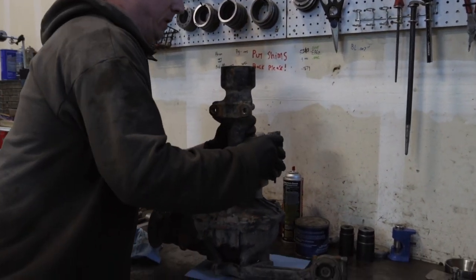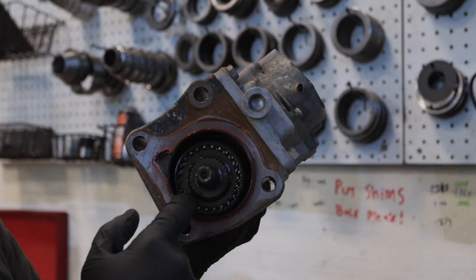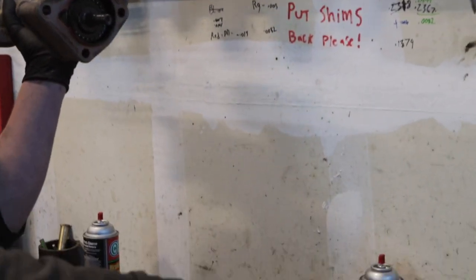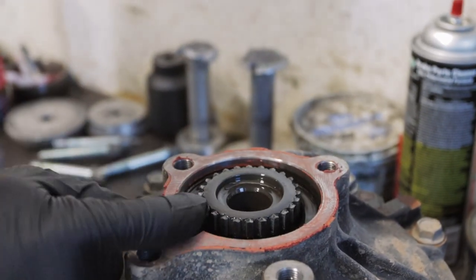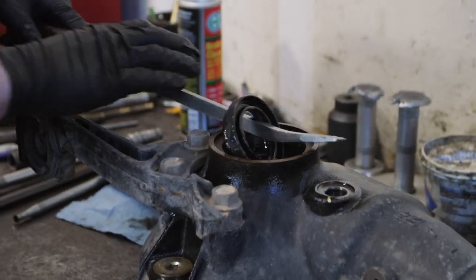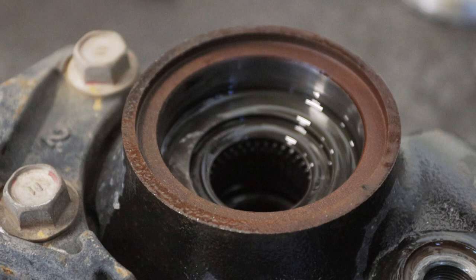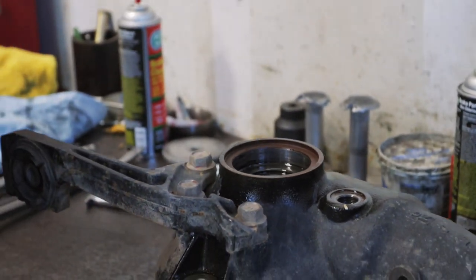Just a little wiggle — bam. So that's the inner part to the ADD actuator, and then this is where the ADD shift sleeve connects to the other side of the diff, making it possible for four-wheel drive. And that's actually the needle bearing that we're going to be replacing, but we'll do that at a later point in time.